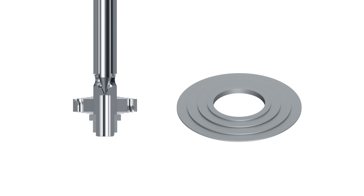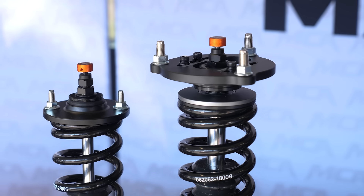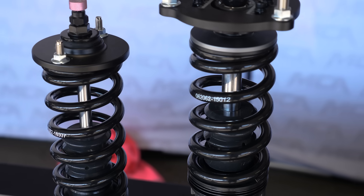Feel is one side of the equation, but performance — controlling the tyre contact patch and the resulting grip — is also significantly impacted by the valving. Valving is sort of the king of it all, probably around 70% of the setup. From a comfort set of shocks right through to a race set, it might only change a few kilos in spring rate, but the valving will change drastically.